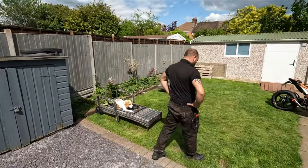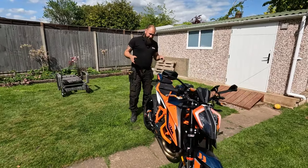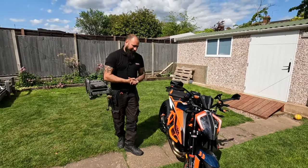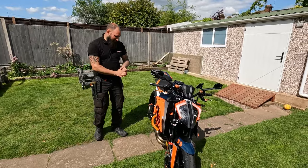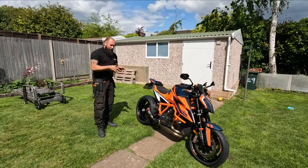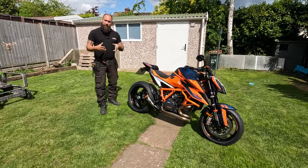Any last words, James? I suppose the only thing to go through would be aftercare. So now it's been ceramic coated, ideally what you want to do is let it cure for the next 24, 48 hours. You can go riding straight away. I think you've already said you'd love to go out riding, and I don't blame you, the weather's nice for it. But don't get it wet for the next 48 hours or so. That's going to allow the ceramic to have the best possible chance of curing on the bike.